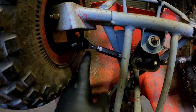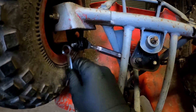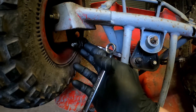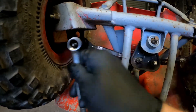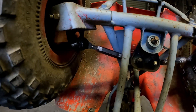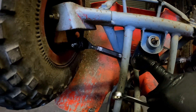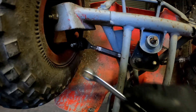If you were to replace these ball joints, all you've got to do is basically crack off this lock nut, remove the nut off this shaft. The shafts on here use a 14mm nut, but they are known to just spin when you try to undo them. All you need to do is take a 12mm spanner — there's a little lock on the back — lock the 12mm spanner behind it, and then a 14mm spanner on the nut, and you can go ahead and unwind that nut and remove it. Once you've got the ball joint off, you can just wind it out and replace it. If you're doing both, do the same on the bottom of the steering shaft and take it off. Put it in a vice or on the floor and replace the two ball joints.